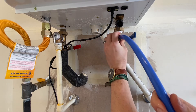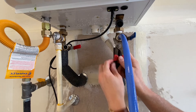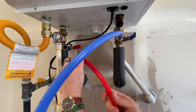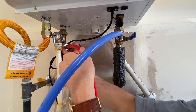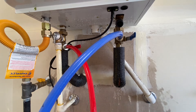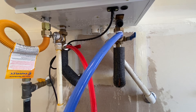The water is pretty much drained out, so now I'm going to go ahead and attach the hose that's going to connect to the pump. I want to make sure that's on there pretty tight, so I'll give it a little extra turn. I'm going to put that inside my five gallon bucket, and now I'm also going to put on the outlet side as well. What we're going to do is pump our cleaning solution in through here, up and out here, going back into the five gallon bucket, creating a nice loop.